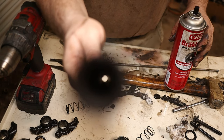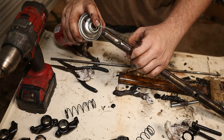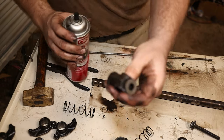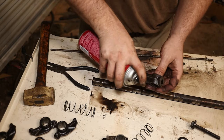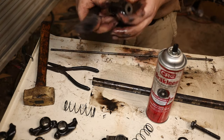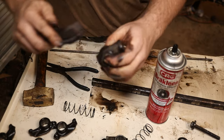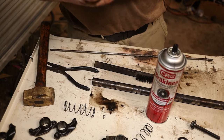You can see it now — it is much cleaner. Now what I'm going to do is fire up the air compressor and use the blow-down tool to clean it. This is an optional step, but normally I'll come through and clean the rocker arms and the rocker pedestal mounts — just hit them with a little bit of brake clean and a wire brush and give them all a good scrub down. I'll check the bearings and also check for play in the rockers themselves. So I'm going to go ahead and clean all these up and we'll be back.